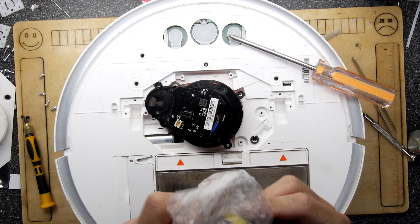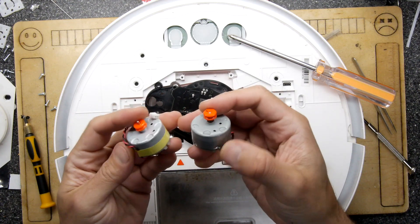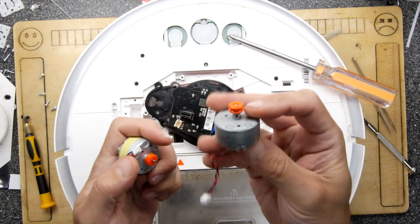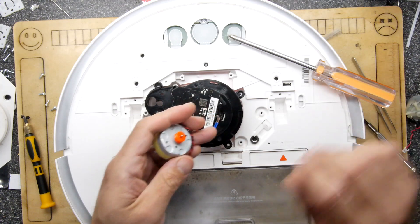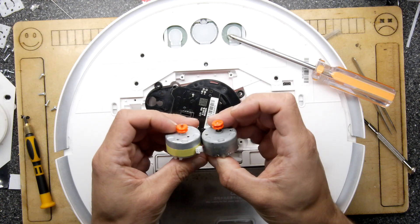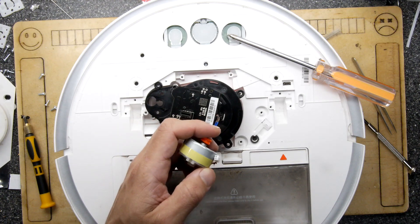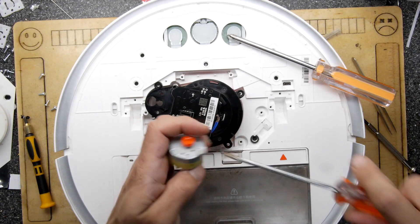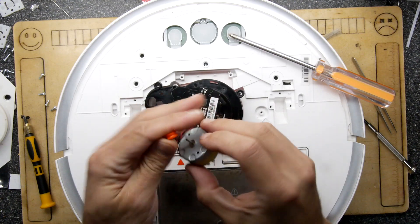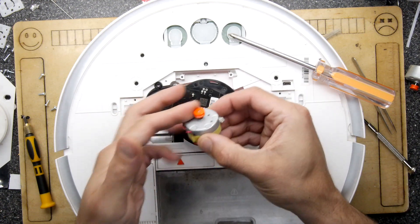I'm just yanking it out. If you're lucky and you get the exact right one, it'll have exactly the same components. This one used to have one of those yellow bands — this was one I actually repaired before; I managed to get another couple of days out of it before it totally died. I've noticed the belt pulley isn't in exactly the same place, so I'm just going to do a test. You can push it up and down, so I'm just going to push it back to where it was on the other one — right at the top, just like that. That's absolutely fine.